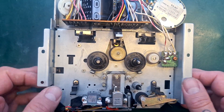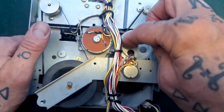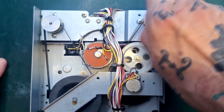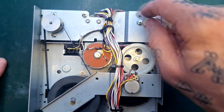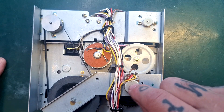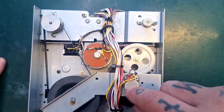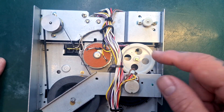In this video we're focusing on the mechanism which raises and lowers the head, and the way that interfaces with this potentiometer on the plate on the back. I noted in an earlier video that if the control belt is missing, you'll hear a buzzing noise when the unit is first turned on because this is going to rotate at full tilt. The reason for that is this potentiometer is acting as a sensor, and the control board is waiting for a specific voltage reading which will signify that the heads are in the lowest position.